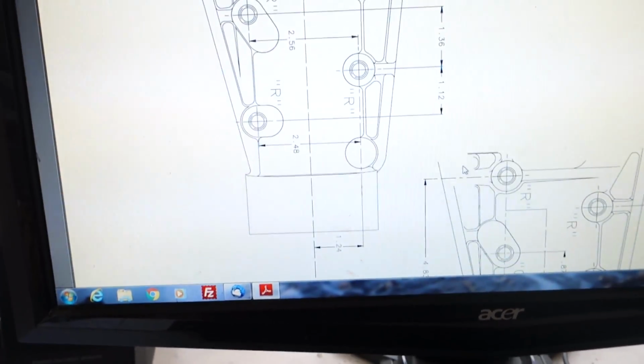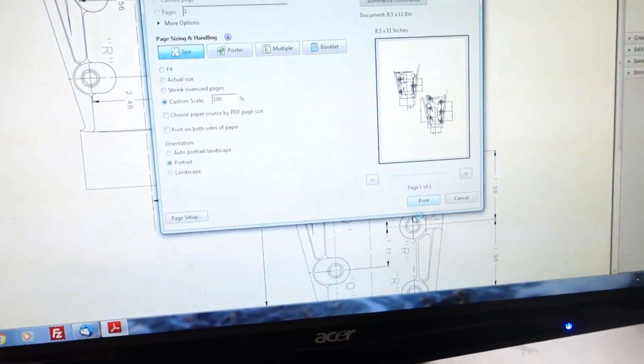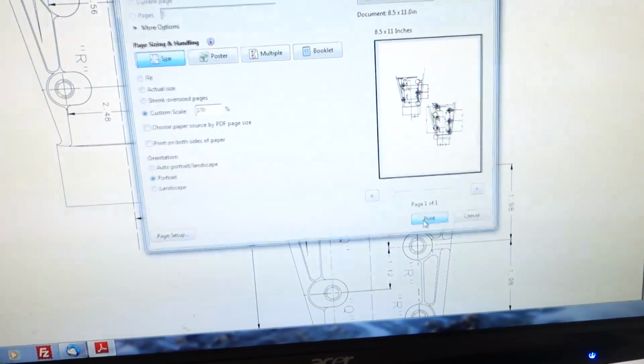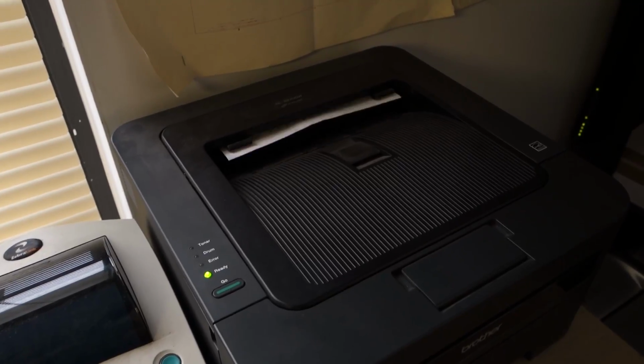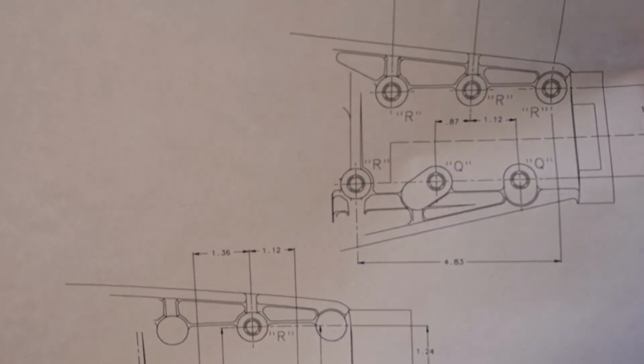All right. That's just what I need. Perfect. So what I'm going to do now is I'm going to go home and take this paperwork and superimpose the 27 spline bolt pattern over the 32 spline bolt pattern, and measure up that Hurst 69 plate I have, and do a 3D model of a new plate that I think should work fine. Let's go home. It's been a long day anyway.